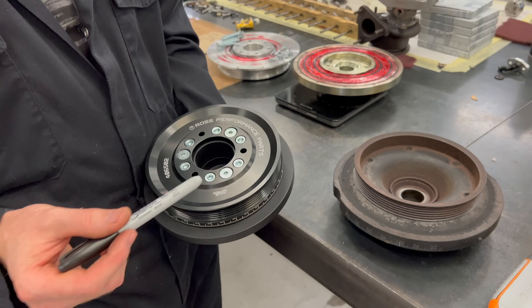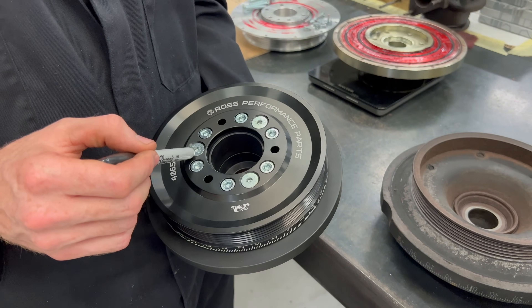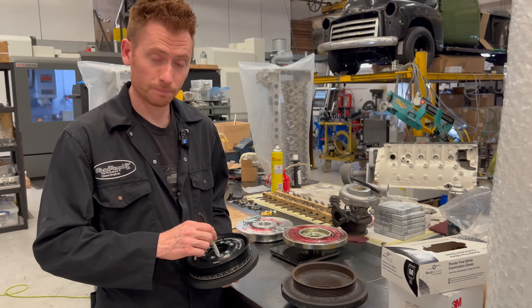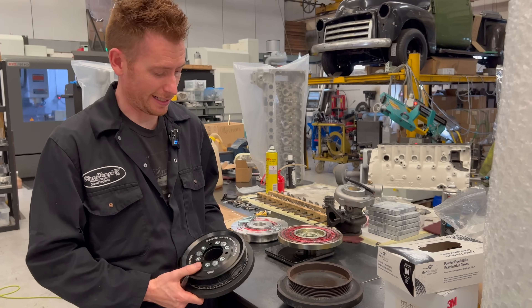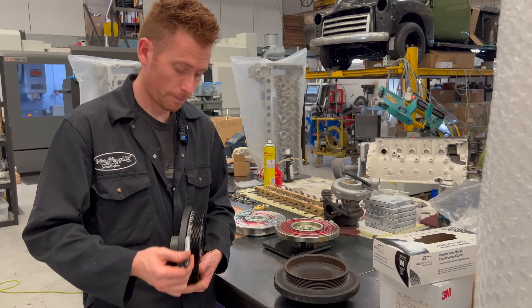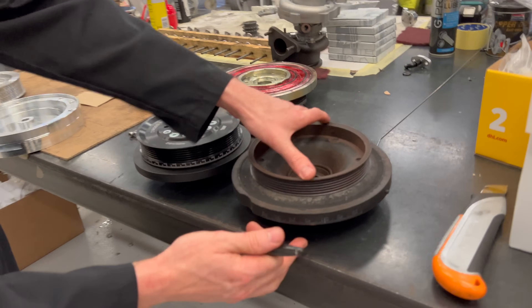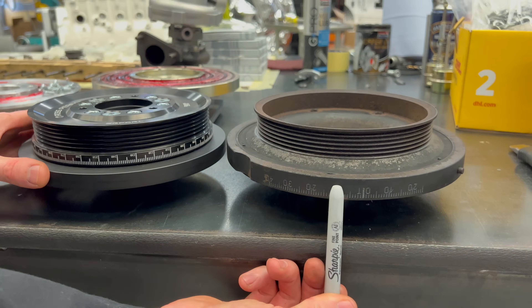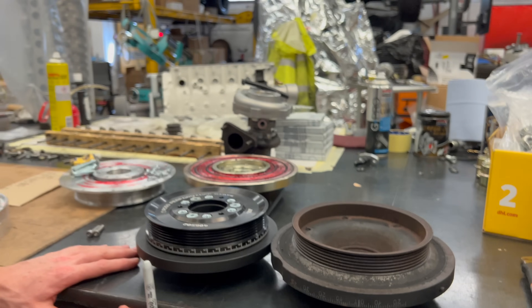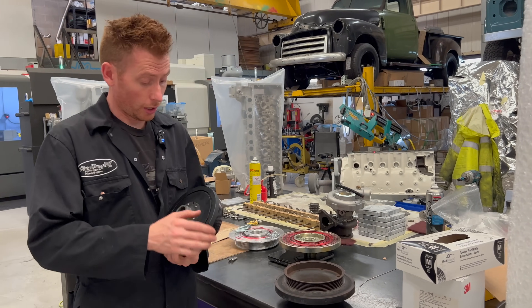I had a little gripe with it — I couldn't take it apart. I wanted to disassemble it, but these countersink fixings have been Loctited in, which they should be to prevent them coming loose, but I couldn't get them undone. Those little Allen key fittings turn too easily. I asked if it was possible to change that — don't know whether they have. Another issue I found is that the diameter of the timing markings is too small. Compared to the original, your pointer would be absolutely miles away from the markings, though you could make your own pointer.